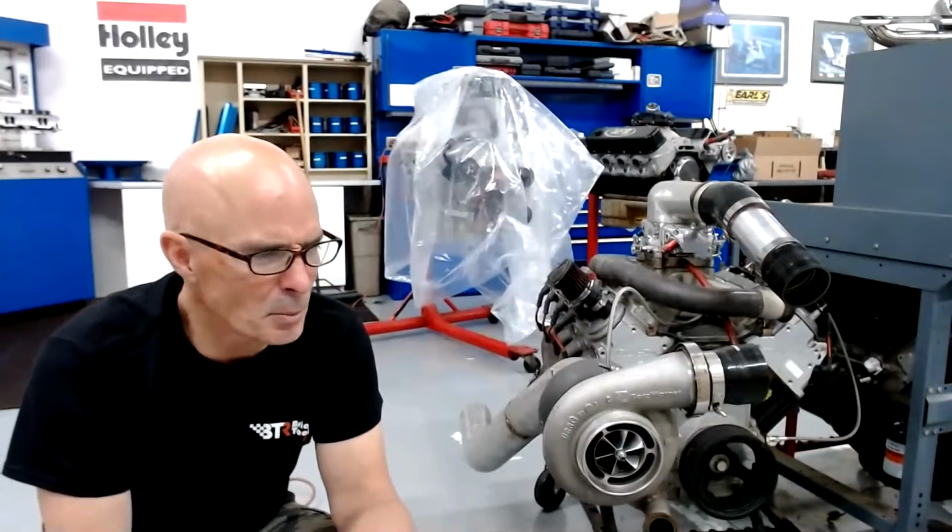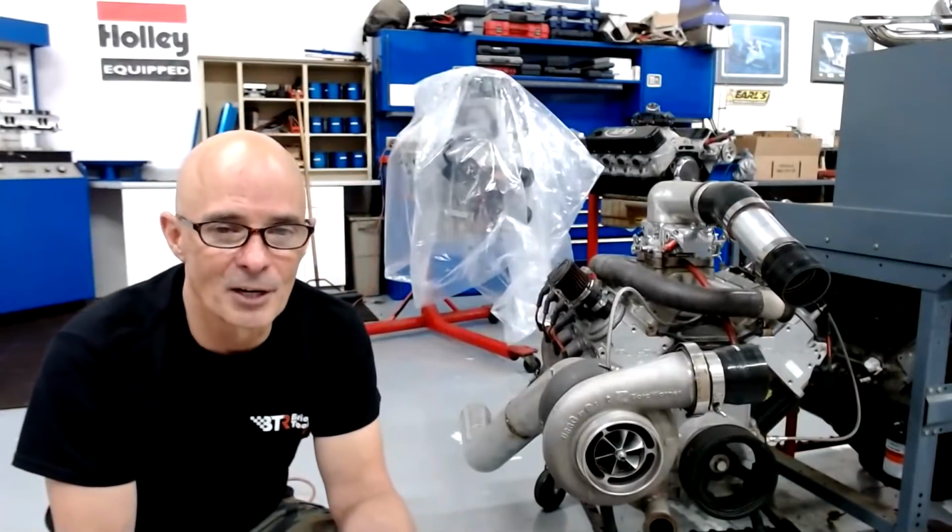Would the air condense in the inner core? Maybe 4-inch would slightly help. Sure, I don't know how much slightly is, though. If I was going to put a turbo on the Magnum engine, which one would I put? I would obviously try the GT45 because we wouldn't run very much boost on the Magnum, but the 78, 75 would also work well.